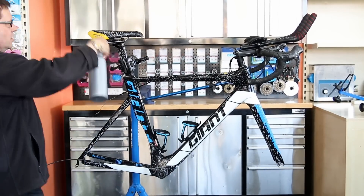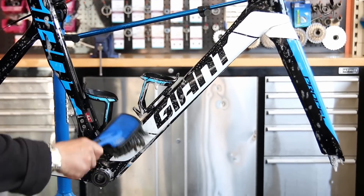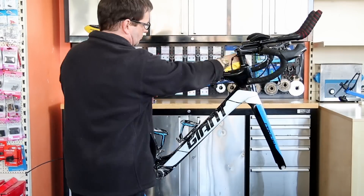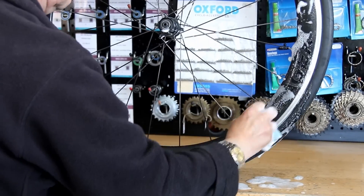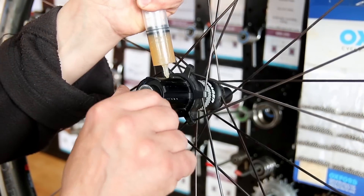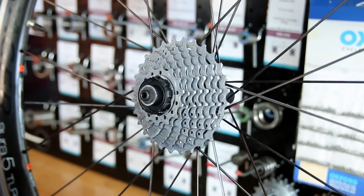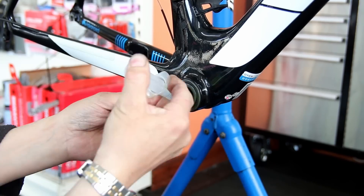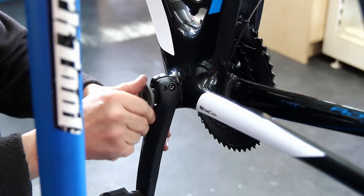Now we wash the frame down using our big softy nylon bristle brush. This bike didn't really need polishing — it was in pretty good condition when it came in, it had just had that wet stage through the winter with a couple of bits needing addressing. We dry it down with a microfiber towel, then wash down the wheels — I like to wash the wheels, check all the spokes and the rim just to make sure there's no damage. We sell a lot of the odds and ends used in this video — greases, the big softy brush, cables — on our website, link in the description. Then we get the bottom bracket back in using premium grease to lubricate the bearing.